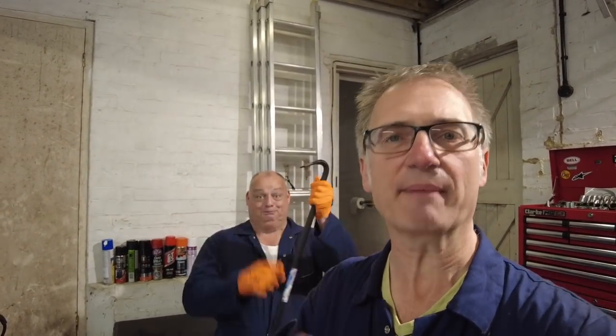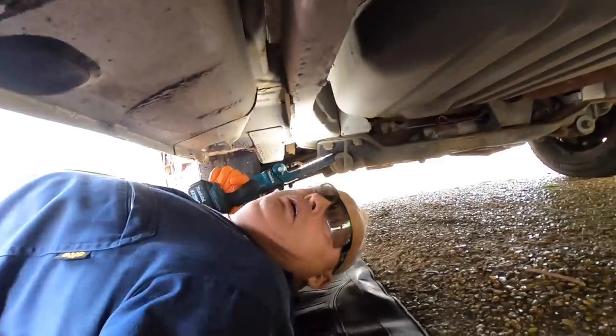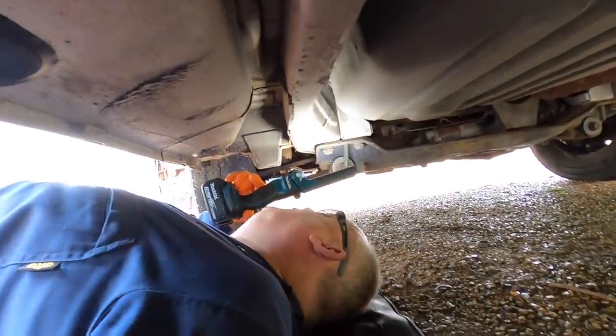So we're going to take a look around Herman underneath with a little screwdriver, and we're going to give it a tap with a small hammer to make sure there are no soft rusty spots and that kind of thing — check out the corrosion underneath. All right, so we are underneath looking at the front wheels.